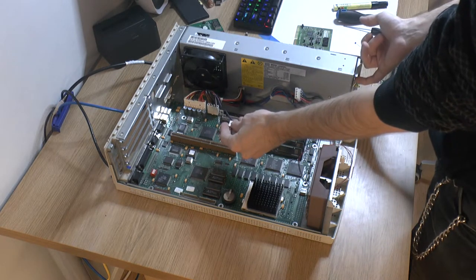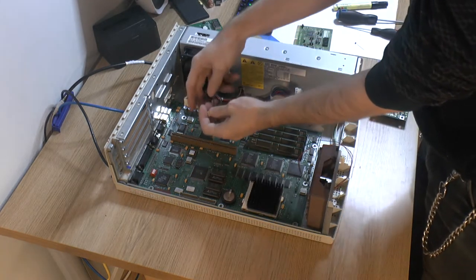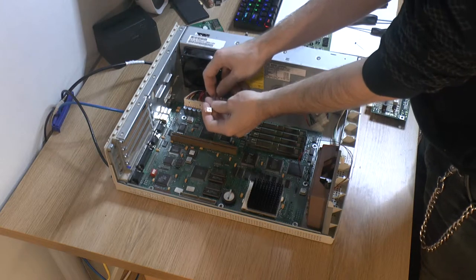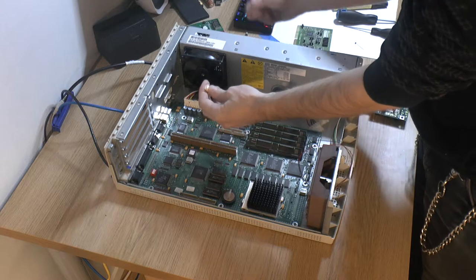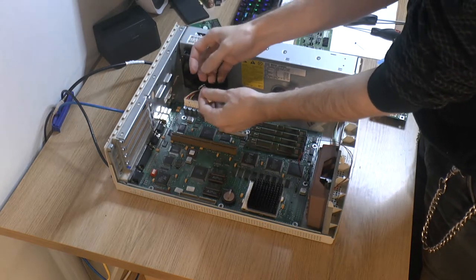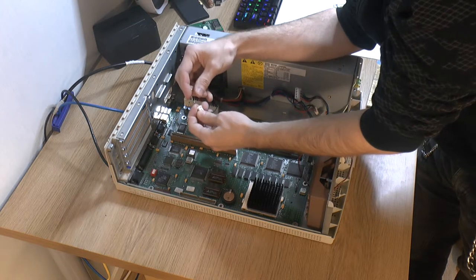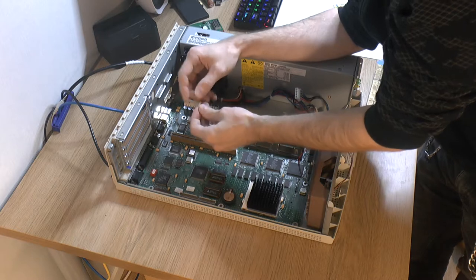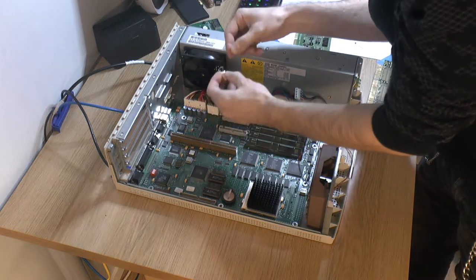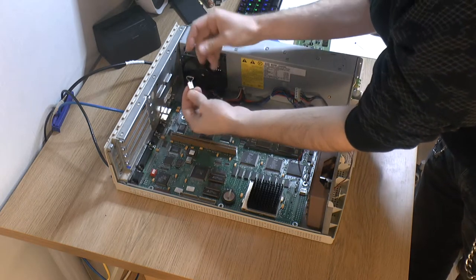having the button in the on position, this is grounded, the black one. And these seem to be positive, around 5 volts or so. So I have these 1000 ohm resistors, 1K. So what I figured out was that both of these positives seem to need to be grounded. So I got the ground over here.